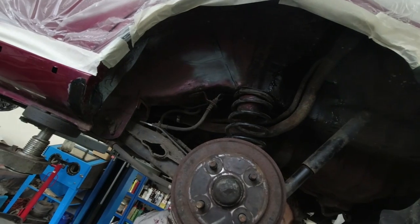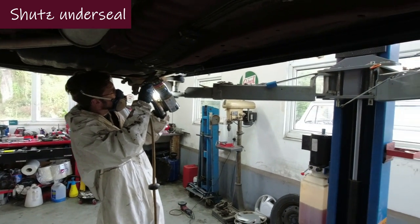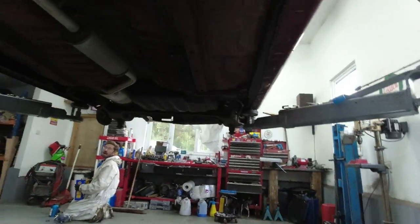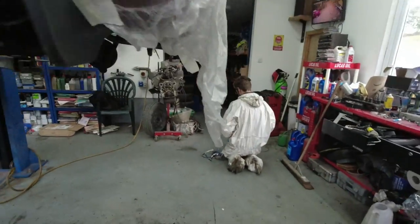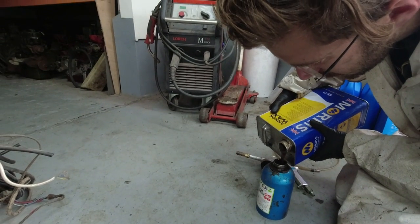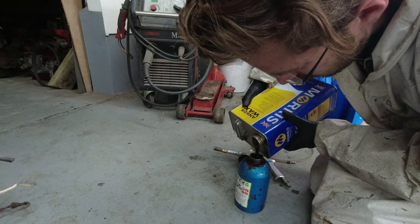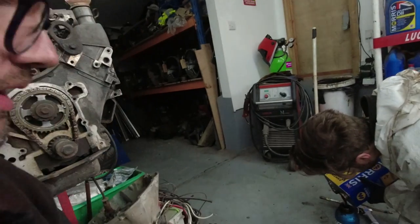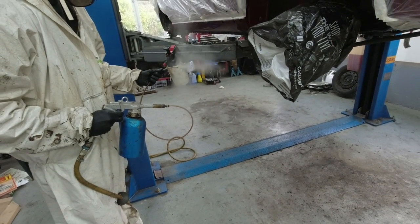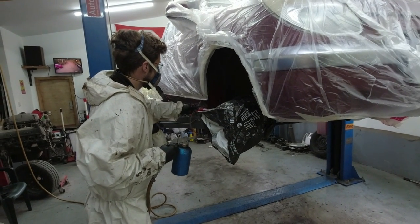It hasn't gone through yet — there's no smell of fuel or anything — so we'll just give it a good coating of underseal, just get the loose off of it. Nice bit of black on the sills done, the front subframe as well looking good. Now Tim is preparing the Anchor Wax — I've never really seen this stuff before. Oh yeah, that is quite runny — much much thinner than wax oil, it really gets into all the crevices. Especially important this time of year because ideally with wax products you want to apply them in summer when they're nice and runny, but even though it's not hot today, that's running nicely. You can insert the lance way deep into the sill and pump the wax right where it needs to be.